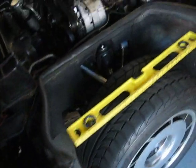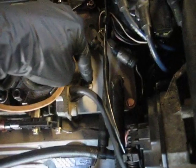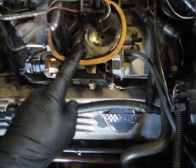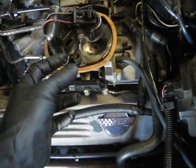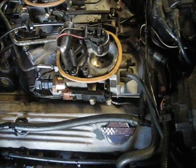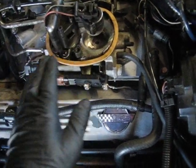Note number two: installation of the throttle bodies. There are three fasteners — two were no problem, but the hole for the third wasn't drilled deep enough on mine. You could add washers to stack it up to bring the bolt head up, but then you can't put the lower air cleaner plate on. So I pulled it back out, hacksawed off about a quarter of an inch, re-tapped it, put it in — no problem.